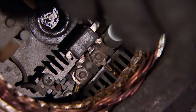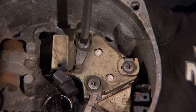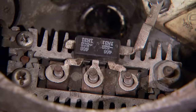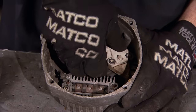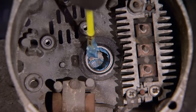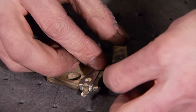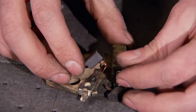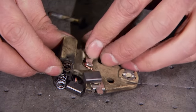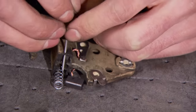Stators rarely go bad, but it does need to be removed to gain access to the parts you will be replacing. Two of the screws holding the voltage regulator down are flanged, and you need to keep track of where they go. Apply a little bit of grease to the rear bearing to make sure this thing spins nice and smooth. The kit comes with new brushes and new springs — even if your original springs look like they're in good shape, go ahead and replace them with new parts just to make sure it's done right. Here's where the brush retaining pin is worth its weight in gold, because you'd have a heck of a time getting the spring-loaded brushes installed without it.